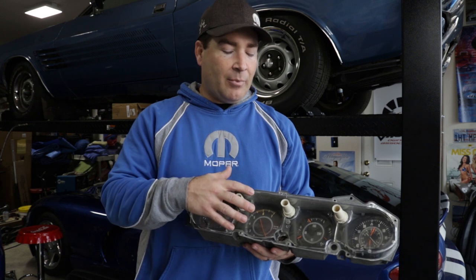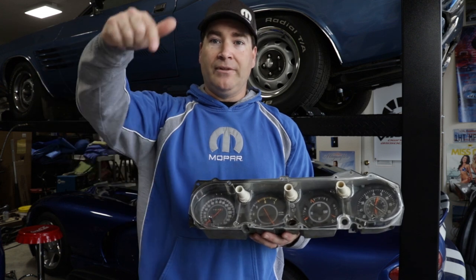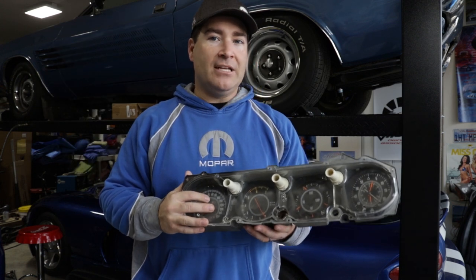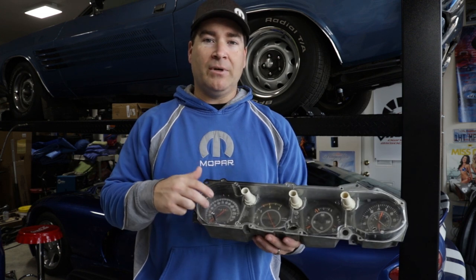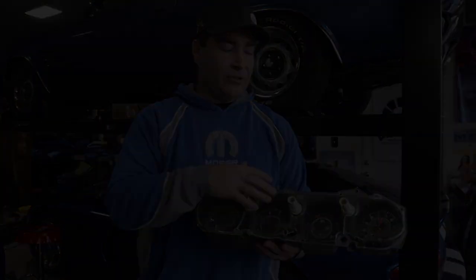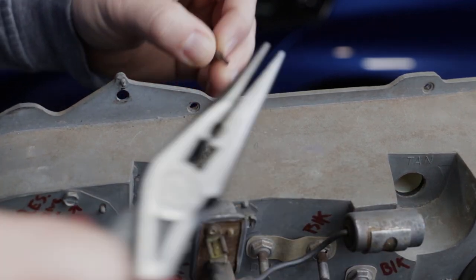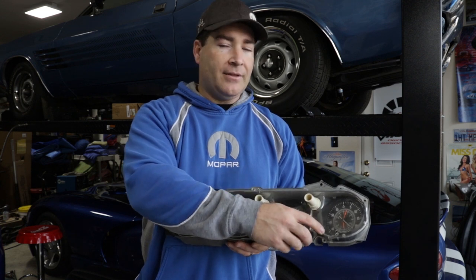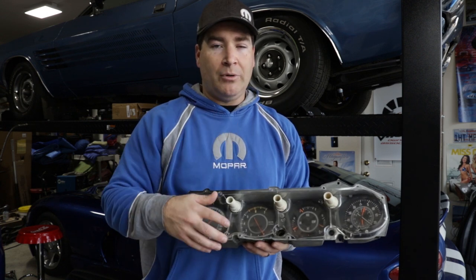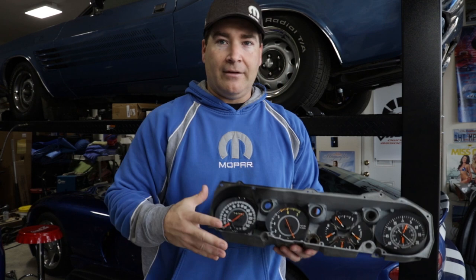Taking apart the instrument cluster once you have it out of the car — if you haven't watched my other video on assembling the dash, I'll include that link in the description below. Once you have the instrument cluster out of the car, taking it down to where you access the speedometer is super simple. There are a number of pins around the perimeter of the lens that you just remove. On the 72-74 rally gauges that have the reset knobs, you need to remove the clock reset knob, which is held in with a screw. Take a narrow screwdriver, run it down the center of that knob, remove the screw, and pull off the reset knob. Once you do that, the lens just comes right off and you're left with the bare cluster.